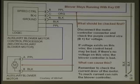By the way, how many of you come across Ford vehicles where the fuel pump keeps running? Key's off, it's running, and you bang on it and the relay lets loose. The contacts stick in the relay, correct? Well, what caused the contacts to stick? High current. Most likely your motor was pulling too much amperage. So if you just put a new relay in, guess what's going to happen? It's going to burn up. You didn't find the root cause of the problem. Absolutely, the root cause was that motor making way too much current.